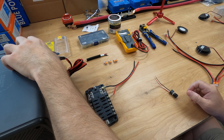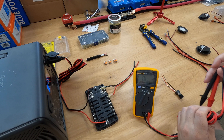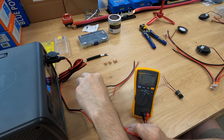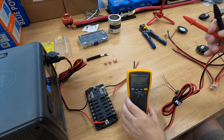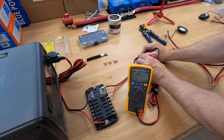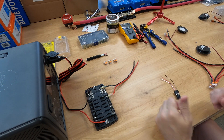I'm going to turn this circuit on and show you a couple of things. First, let's see what we have coming from the battery directly: 13.38 volts. And now, as we look through this first circuit — also 13.38. So effectively no voltage lost through there. I'll bring this out again to show you the voltage at the end of the LED puck light wiring.